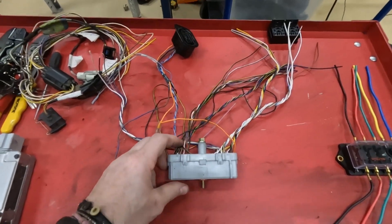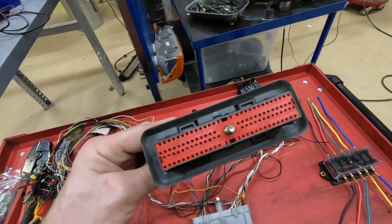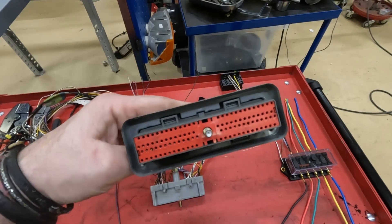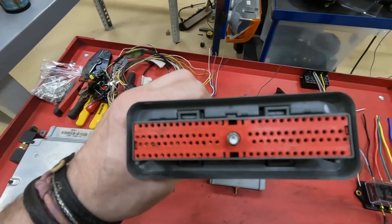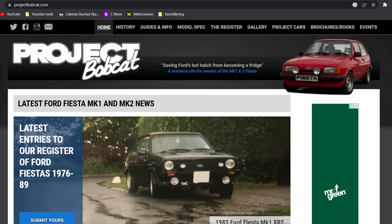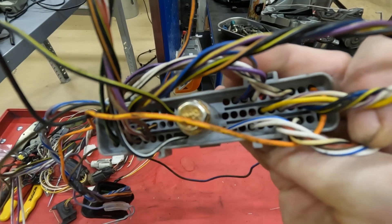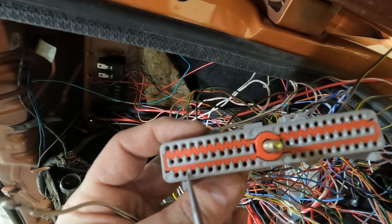I've got the cable here — this is the 60-pin cable, as opposed to the one that came off the Mondeo which is 100-pin. As you can see, the 100-pin has four rows of pins and the 60-pin only has three rows. The 100-pin connector will not fit this ECU because it only has 60 pins, so make sure you get the right connector for the right ECU. On places like Project Bobcat — I'll put a link below — there is a wiring diagram and a wiring guide. I've basically gone along that wiring diagram and taken out any pins I don't need.